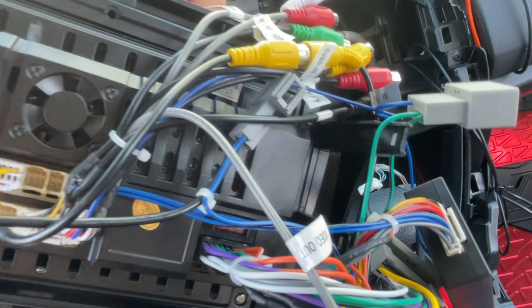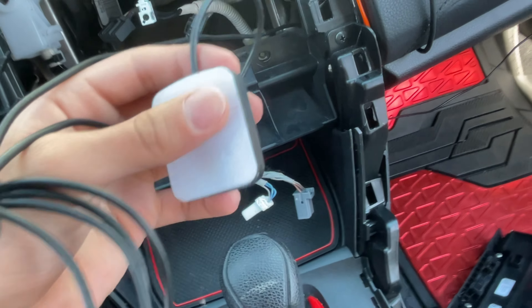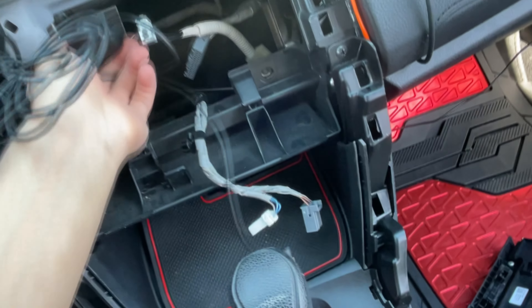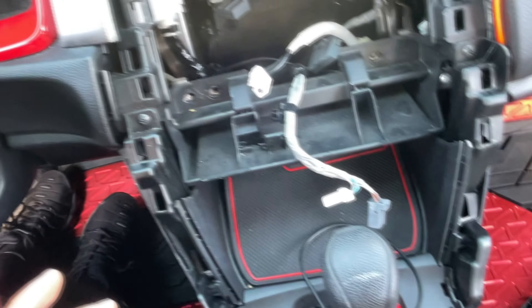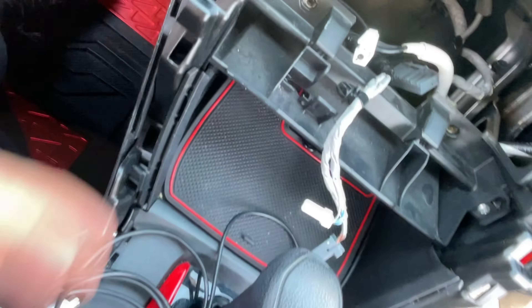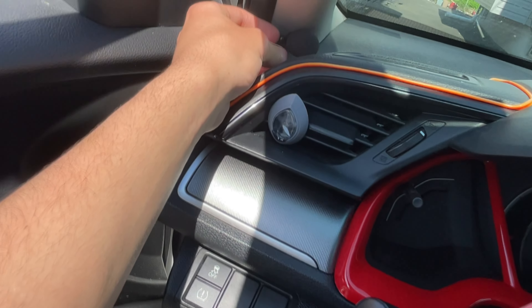The cables are all labeled — it's basically plug and play, like Legos. The instruction manual doesn't do a great job but it's simple. I have the antenna cable and USB cable plugged in already. For the antenna cable, just loop it inside if you don't use it — I use CarPlay so I just stick it in there. Connect the cables from the original car into the extension cables. For the microphone, stick it inside, route it out through the driver's side, loop it underneath the car, and plug it up all the way over.